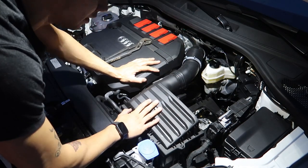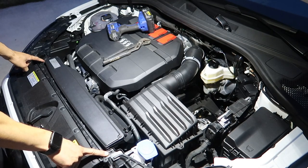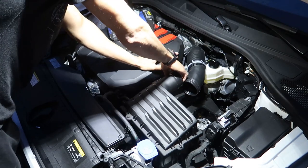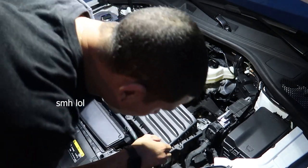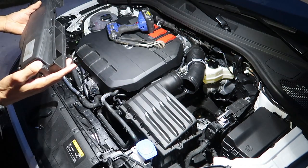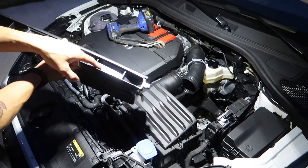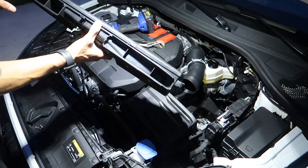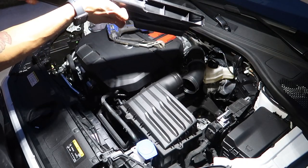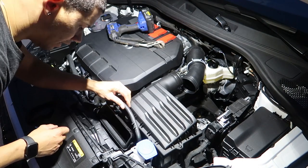These should be able to pop this out, pop this out, and slide a new one in. All right, so we got these screws out — one here, one here. Already breaking stuff, we'll see. Sitting like this, you got the air dam — like this is barely... as you can see here, no air is going in there. It was only coming through here and there was just this flap — so the flap would be closed and it would direct it. Yeah, this other intake will definitely have a lot better airflow. Wow, I didn't realize it was that restricted.